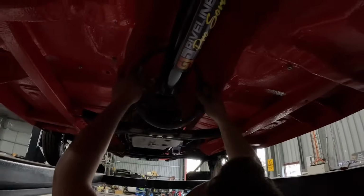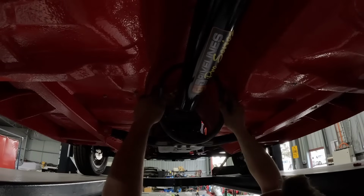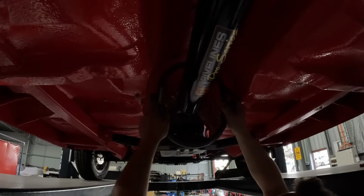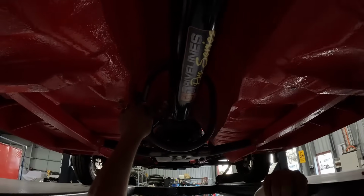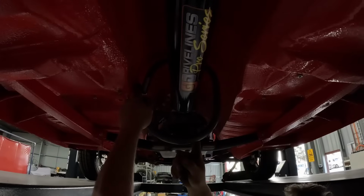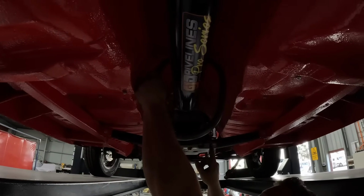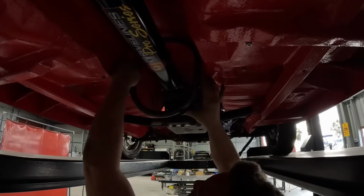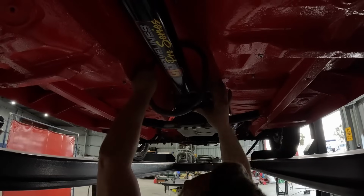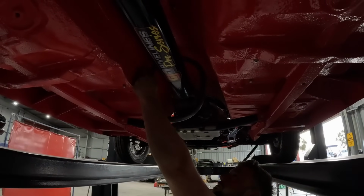Alright, so we're going to take this up here. Tail shaft loop wise, height, everything, that worked out really nice. And you'll see a big slit here, and I'll show you more about that in just 2 seconds. But I'm really happy with that. We're going to make it about 300mm backwards off the extension housing back here, and we'll tie it back with a couple of 7/8 chromoly tubes. But as far as shape, I'm really happy with that, and it's going to close up a little bit more when we pull it together, so yeah, stoked.